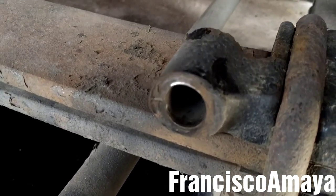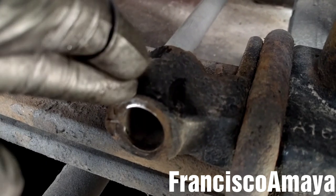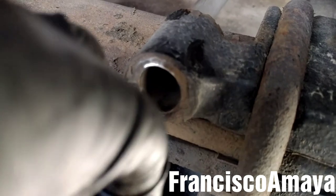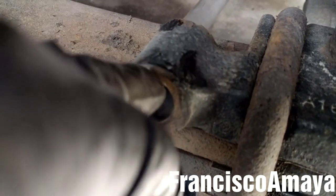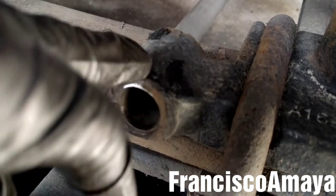Because it damages your mounting bracket — the shock absorber mounting bracket on the lead frame. As you can see, the orifice is bigger now. It's still okay, but in some cases it can damage it more than that, and you will need to replace it.